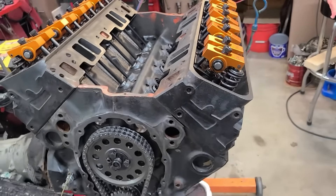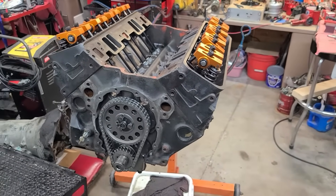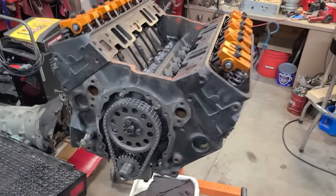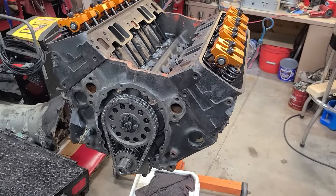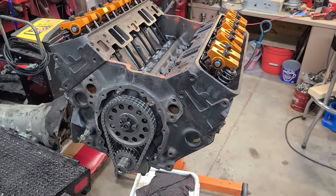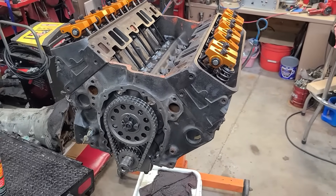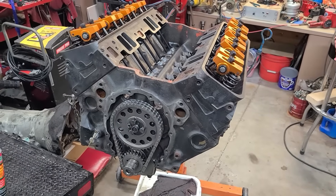To prove this out, I do plan on putting this on the run-up stand that my buddy built. I might get a timing cover and cut it out so you can see the timing chain and gears and where the dots are. We'll install it dot to dot, drop in the distributor, and see if it starts. Then we'll pull the distributor, line it up at 12 and 12, restab the distributor, and see if it starts. One way it's going to start and one way it's not. Anyway, that's just a quick look at something I see argued online all the time. If you have thoughts about it, let me know, and the next video hopefully I'll have this thing on the run-up stand.